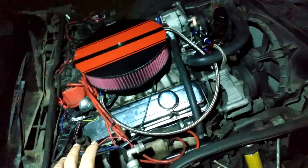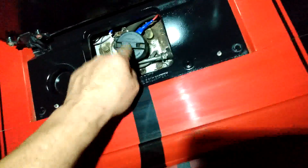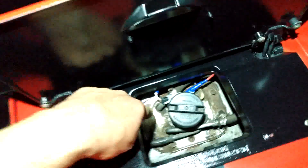The first thing I wish I would have known — I'm going to start in the back of the car. If I would have known to begin with that the previous owner had swapped out the fuel pump to a low pressure for the carburetor, I probably wouldn't have had to do everything I did up front, but he didn't tell me that. Guys, if you're going to do this swap, make sure that the pump you have — these are nice because you just undo these bolts here and this thing pulls right out, and you can switch the pump out.